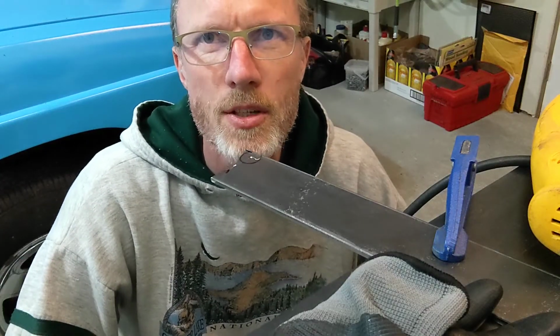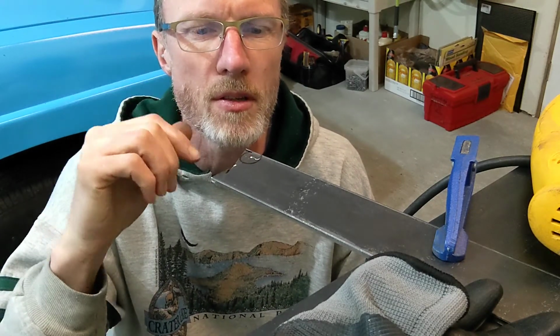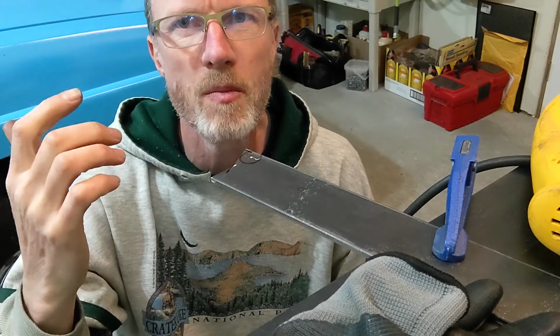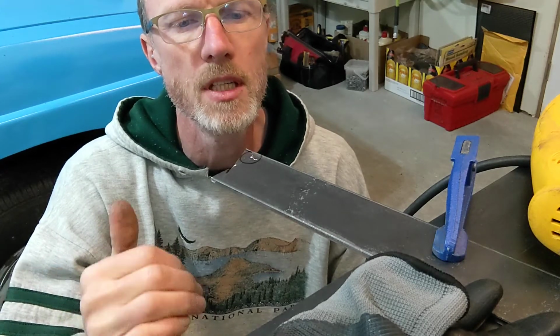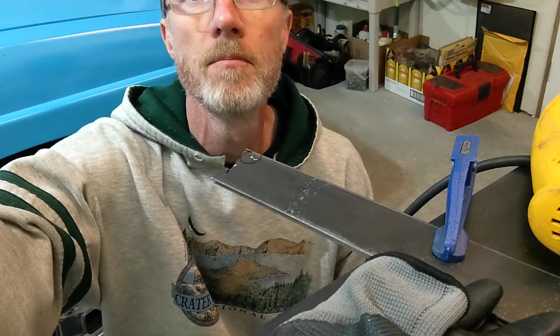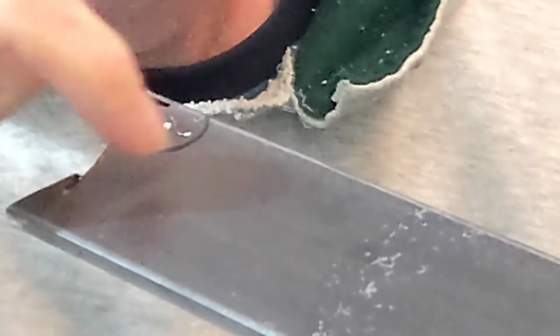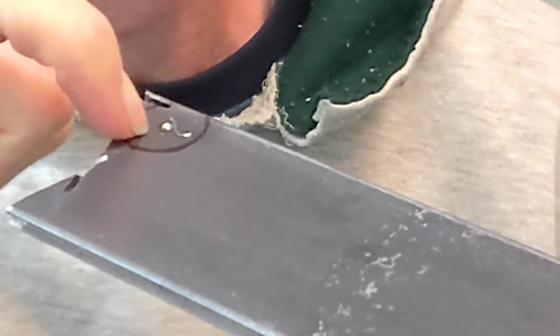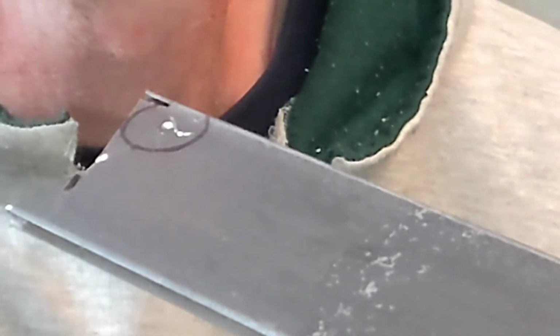Okay, I couldn't find a washer that fit that peg right. It's always play, and they weren't really proud enough. So I'm just gonna make one. This is 1/4 inch mild steel. So I'm gonna basically cut this out. Well, I'll drill the hole first, which I think I have the right bit for, and clean this guy up, and that'll sit on that crown. All right.